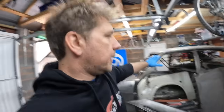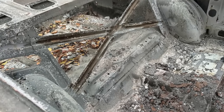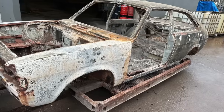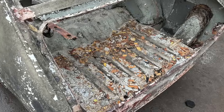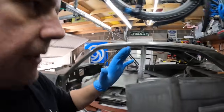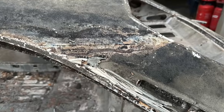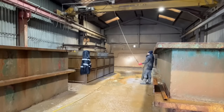Welcome to phase one of the long door coupe. I'm going to go through the process of this bare metal when it went to Enviro Strip, which are in Tamworth. Basically the process is it goes into an oven and gets baked to around 400 degrees or so - not enough to distort any panels, but it loosens all that paint, all the bitumen, and obviously the lead areas. Up here on that seam is exposed, and all those spot welds on the roof are visible, which means they can be drilled out and that whole quarter panel will come off quite nicely.